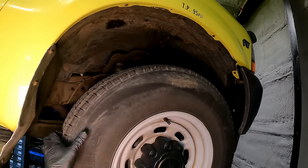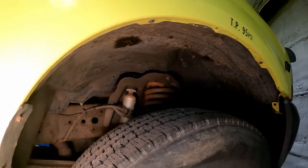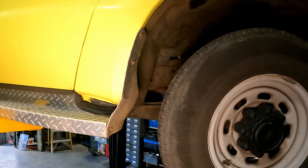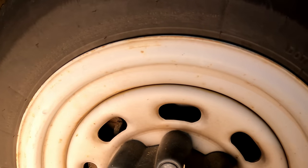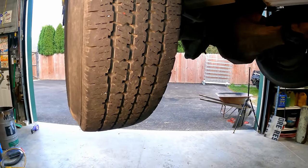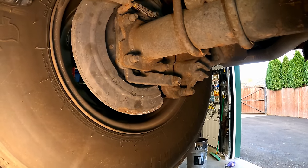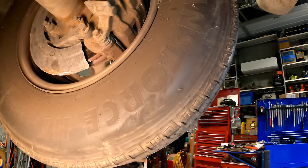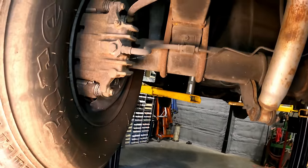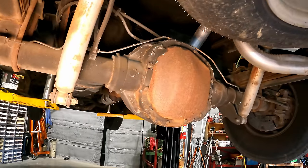We're not doing a full inspection, but shakedown on the front end components, nice and tight. We got newer Reflex shocks, about 8-9/32 on the front pads. Same thing on those rear pads, about 9/32 from seeing on the outside. The tires, about 7 or 8/32, and a little bit of dry rot starting on the outside. These are from 2014 though. Yep, plenty of meat on the inboard pad as well. Just taking a peek at them.